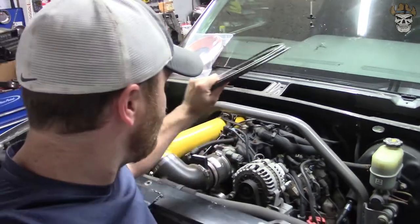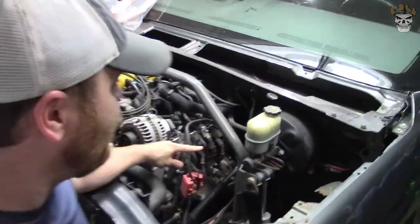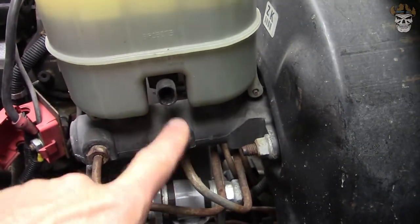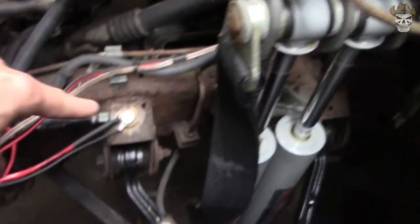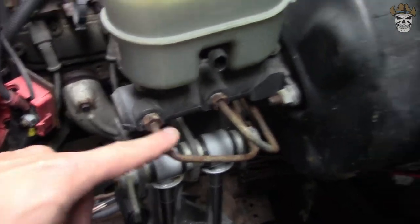Since this is a dune truck and off-road rig, I'm going to use the steel line because it offers better protection against ramping, moving around, and rubbing through stuff. I'm also going to eliminate the ABS on this truck. The first piston on the master cylinder is for the front brakes and the secondary is for the rear. Instead of going from the master cylinder all the way down to the ABS unit and back, I'll go right from the master cylinder to the brakes. First, I want to pull the tires off, break the bleeders loose, drain the reservoir and all the lines, and then we can start making our brake lines.